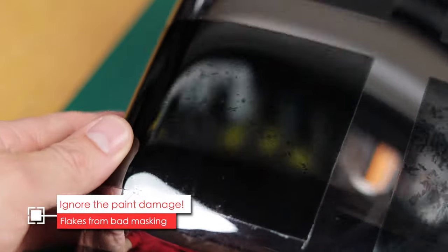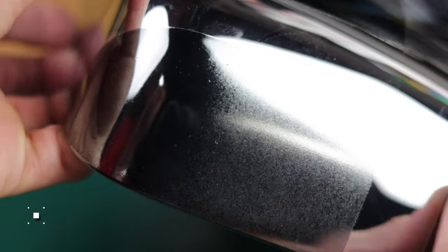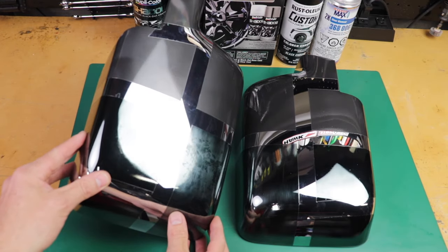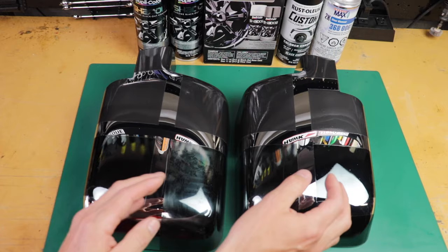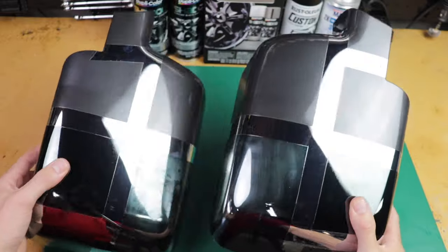It's been about a week — let's take a look at the finishes. The black chrome with lacquer clear has some solid orange peel; it was pretty smooth before the clear coat. With adhesion promoter there's a lot of texture, and you can see the scuffs through the translucent Shadow Chrome. With the black chrome you can see the three-layer versus two-layer difference — not too bad, a bit less noticeable orange peel with adhesion promoter. Comparing the lacquer clear on the left to 2k clear on the right: the reflectivity and smoothness of the 2k clear finish is so much better, as expected from a $20 can.